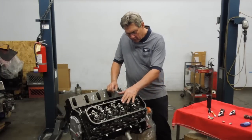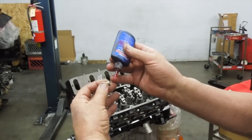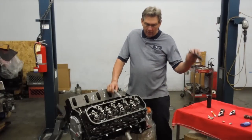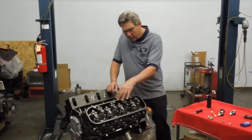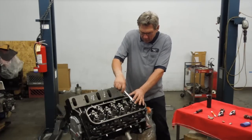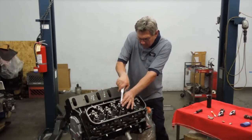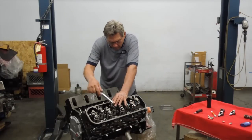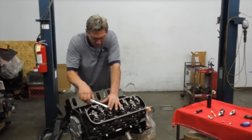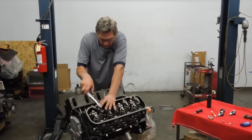I've taken all these nuts off. After I did the initial adjustment and everything came out fine, I pulled each one of these nuts off one at a time, put Loctite on the first three threads inside, and then as I screw the nut back down the stud and re-tighten it with a quarter inch nut driver, it'll take that Loctite and work it all the way down the threads. What I'm doing now is just going across using my torque wrench and tightening each one, making sure it's where it's supposed to be. See this one's a little bit loose - just click in. Most of the time I do this by hand and go over it and double-check it with the torque wrench.